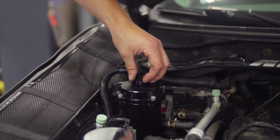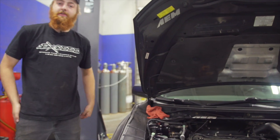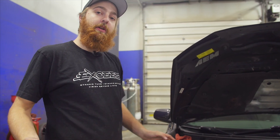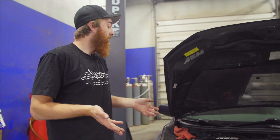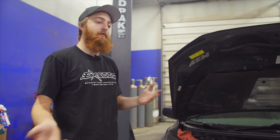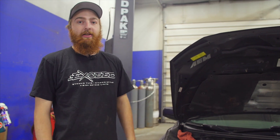After you get it assembled and topped off, you want to reach the middle of the sight glass with your fluid level. We also recommend turning the car on, moving the wheels around a little bit, and then rechecking the fluid level. In theory you shouldn't need to re-bleed or burp the power steering system, because essentially all we did was drain the reservoir, add a new one, and refill it. But just to be safe, start the car, move the wheel, and then recheck the level.